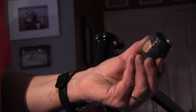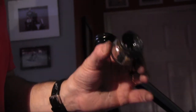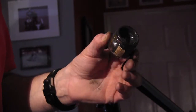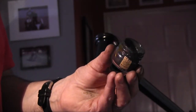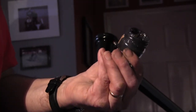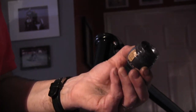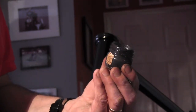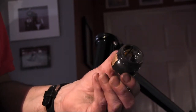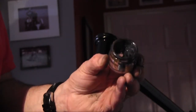One last point I forgot to say. When I'm assembling, I normally keep little jars of, I can never say it right, molybdenum grease, like black grease, very good on threads. I don't know if you can still get this easily. I've had a big old jar of it for years, and I just take a bit out and put it in a little small jar, and I tend to have it around when I'm assembling a bike. And every time I put a fastener on, I use a little bit of this or copper grease, whichever I've got to hand. But this one's my favoured one.